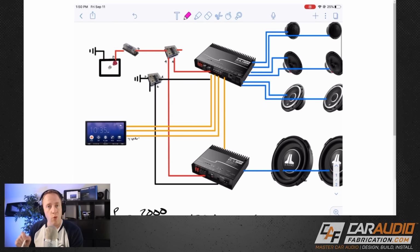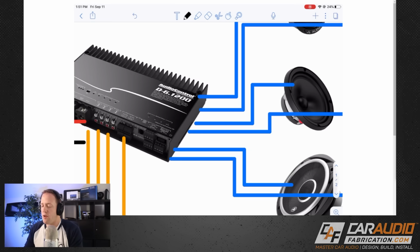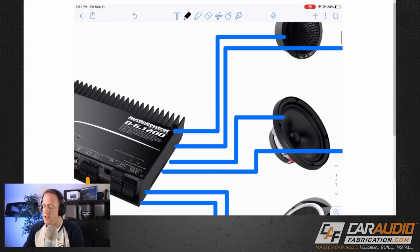We need to know how long each of these runs is. And a good way to do that is to go out to the vehicle, and you can use a piece of string, or you can just estimate with a tape measure. And then I like to usually add 10 to 20% to that final calculation for all of your total lengths. That way you make sure that you have enough wire. If you've taken your time creating this diagram, you could use it as a visual guide as you're going through and taking each of these measurements.